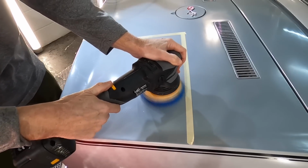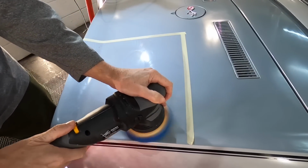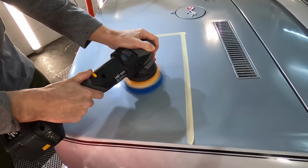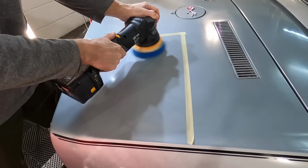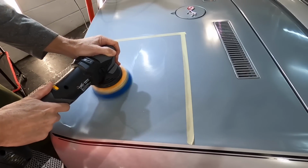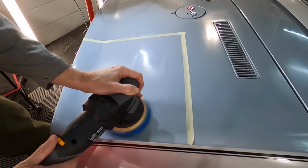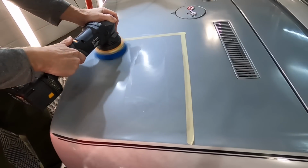Now this Corvette, the paint is very, very thin, especially around the edges. It's actually just naturally worn in through to the primer. So correction, a two-step correction, wet sanding, out of the question completely. It needs something light. It calls for something that's non-aggressive, just like this Sonax ceramic polish all-in-one to correct and protect in one fell swoop without removing any measurable layer of paint whatsoever.